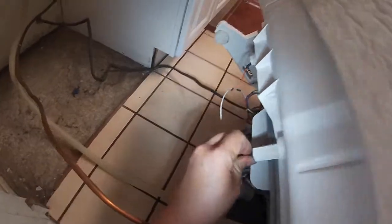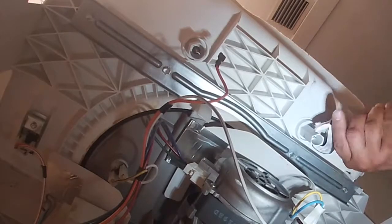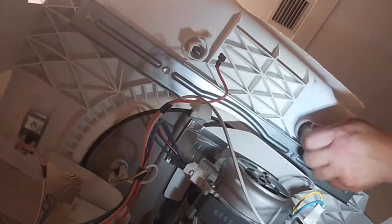This dishwasher was very tight even when I got the legs loose. As you can see, I have the copper water line — look for something to hold the dishwasher and keep it tilted so you can do the job. These are the two terminals on the heat element. Remove the two terminals from the heat element — if you cannot do it with your hands, use a pair of pliers — then remove the two nuts that are holding the heat element in place.